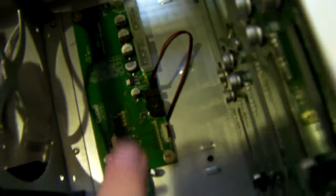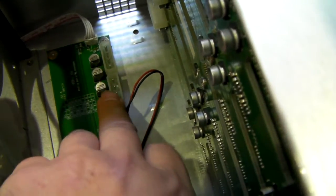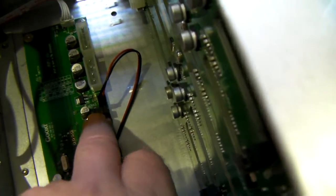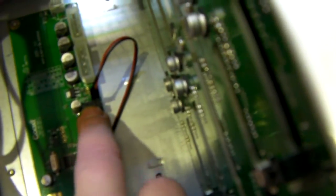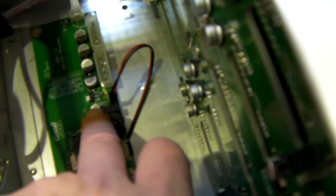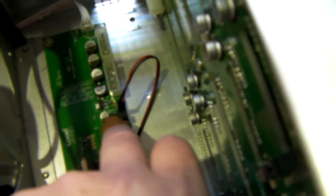On the daughter board where the fans connect, which is powered by two Molexes, you'll see some jumpers. If you're using a Supermicro board and you have this problem, just remove the first and maybe the second jumper — flipped the other way towards the back of the case. That will put a minimum speed on the fans which is still quiet, but it will stop it giving a warning.